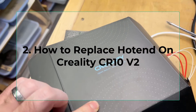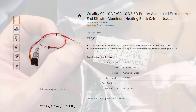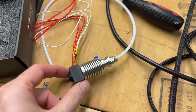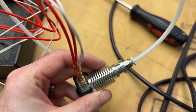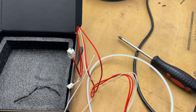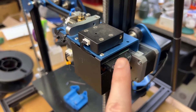Now, how to replace your hot end on the Creality CR-10 V2. I went to Amazon and purchased a Creality official all-metal hot end - I'll put a link in the description below. It comes fully assembled, ready to install on your 3D printer. To install the hot end, all we need to do is disassemble our old broken hot end. We'll need an allen wrench set or hex head set to do that. Then we just plug it into the control board spot that's behind the shield.